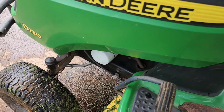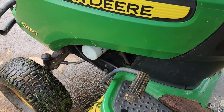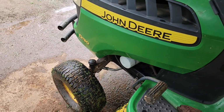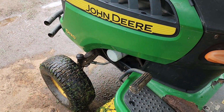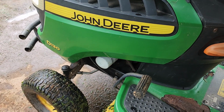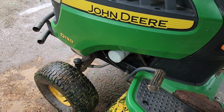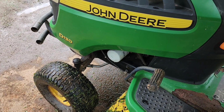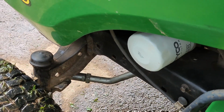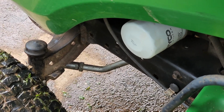But I noticed that the lock nut wasn't tightened right up. I could move it back, but I couldn't shorten the rod anymore, which I needed to do to adjust the toe in. So, fortunately, I was able to get into position. I was able to take the rod end off and swing the rod out into the clear, and I took about 10 millimeters in length off each of the rod end and the rod, and just cleaned up the thread a bit and put it back on, and it's almost perfect.